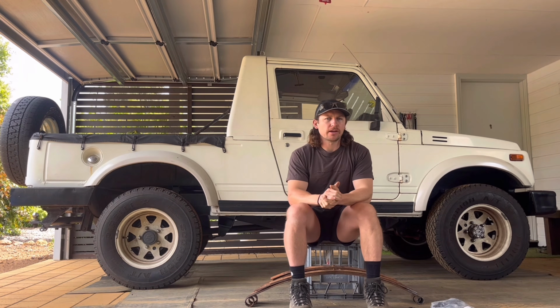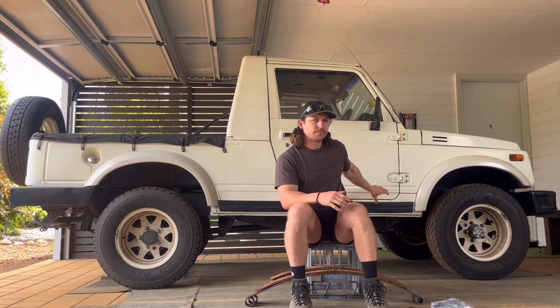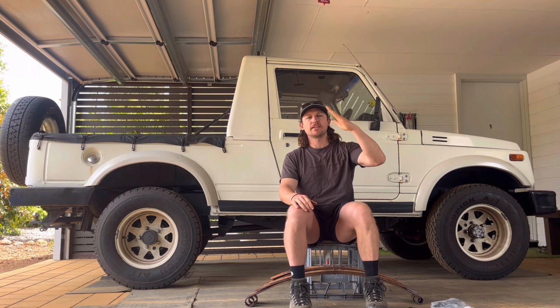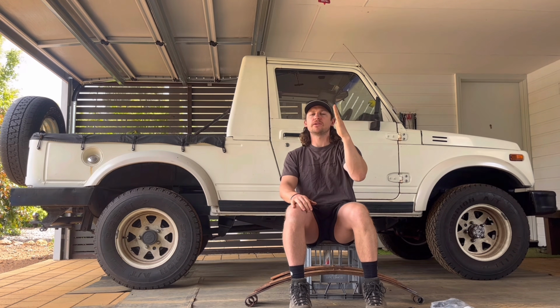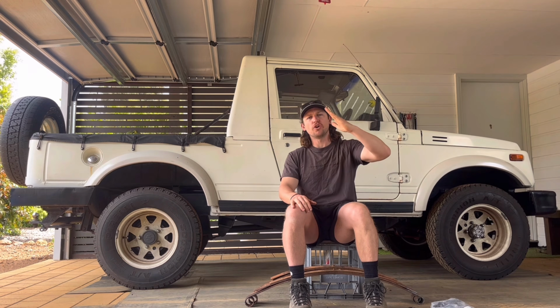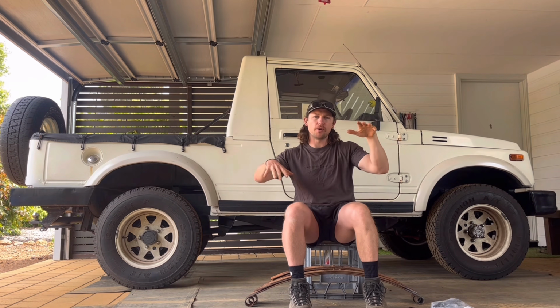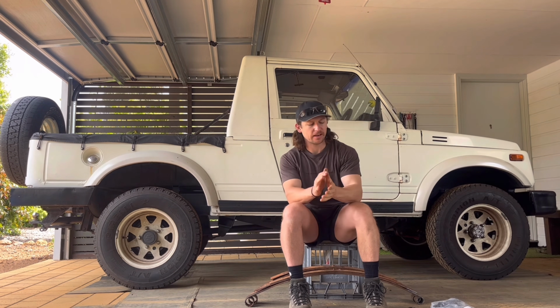The third way of going about this is leaving the rear hole, leaving the front hole, and just having your shackle on a really disgusting angle like this, which I have seen on a few rigs, and I'm just not a fan of it because it creates a lot of body roll. Your shackle should be on an angle like this, not really out here. It just allows a lot more play in the leaf, in the body. You want your shackle approach to be about that.